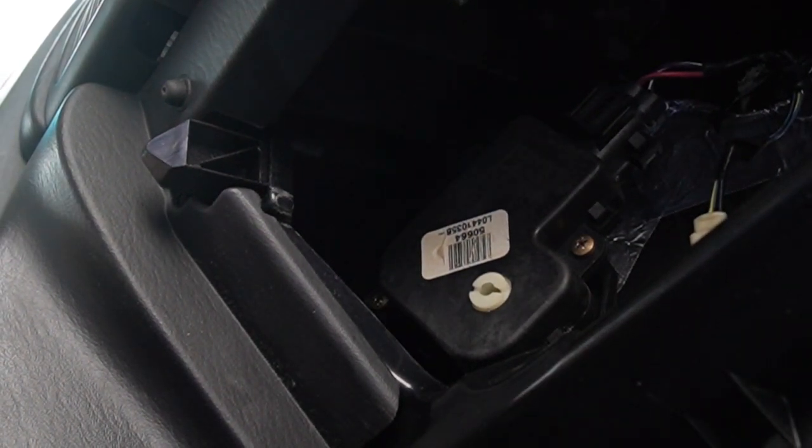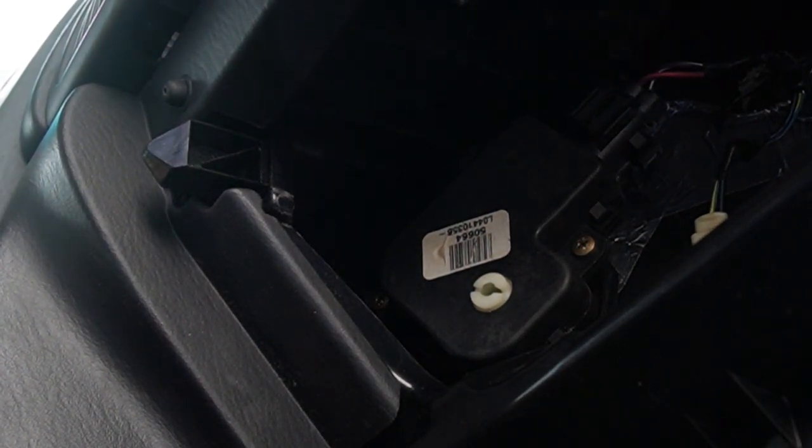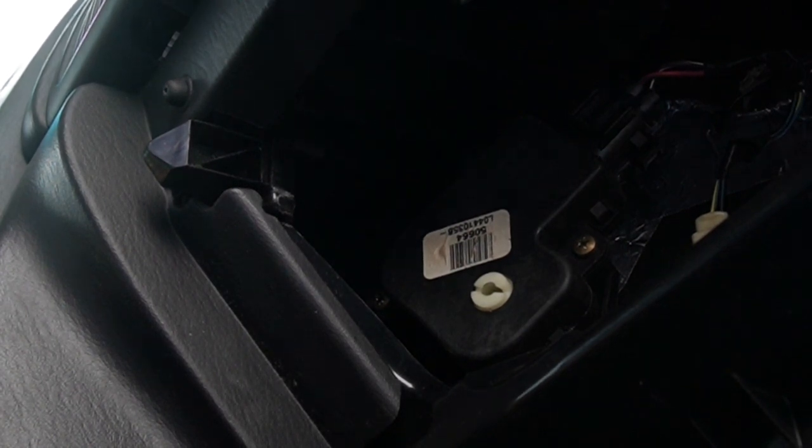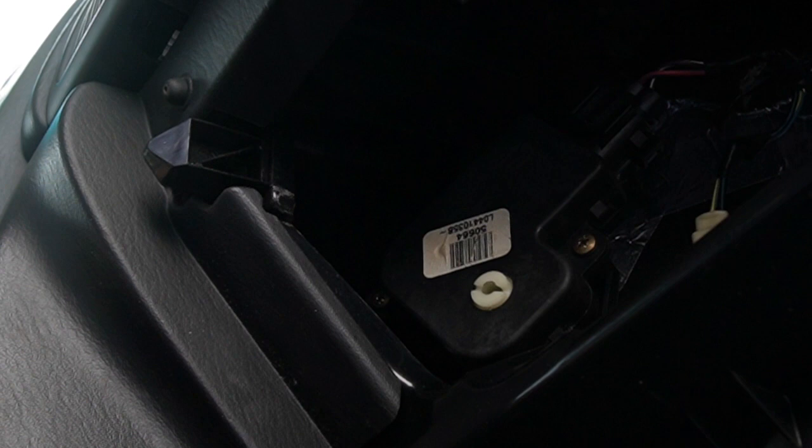Alright, so we're back, and the trick is: you have to turn your ignition on, let the computer get power for a minute, and then shut your ignition off and leave your ignition turned off for about two minutes. That will trigger the recalibration cycle.